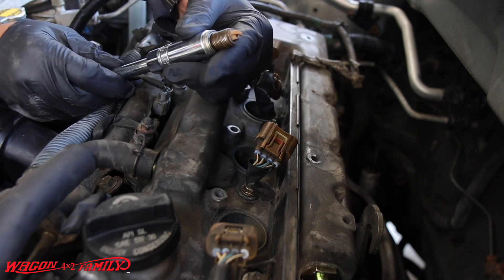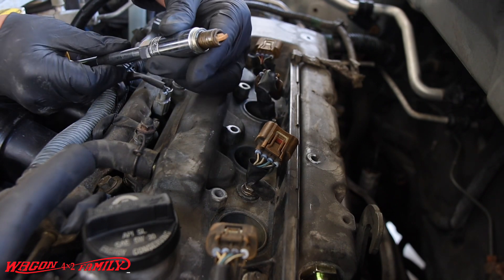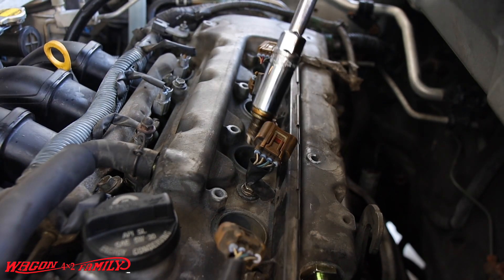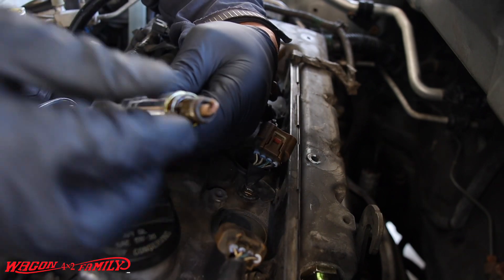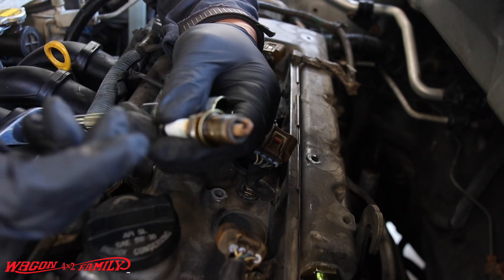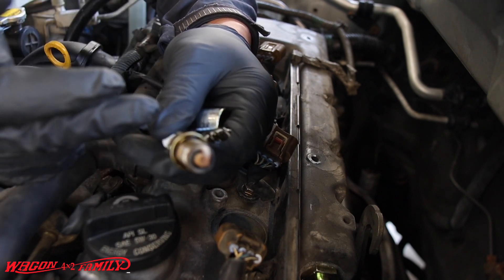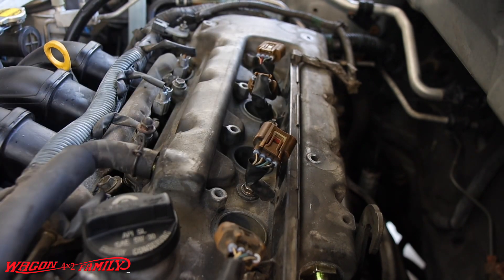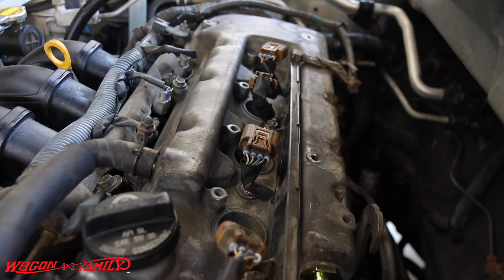These plugs are pretty bad — all corroded and heavily oxidized. There's no oil down in here, which is good. This one also has a little oil on the very top but not the tip, probably because of the oil leak in the valve cover gasket. Now that's been replaced, I'll check this number three spark plug next week. This one's also heavily oxidized, so it's a good thing we're replacing all the plugs today.